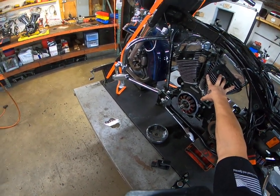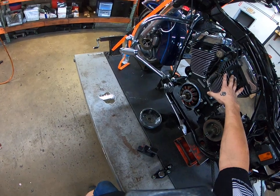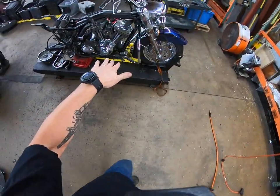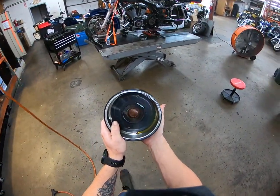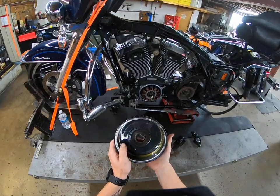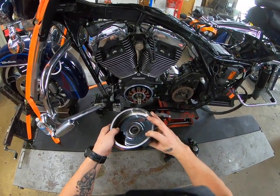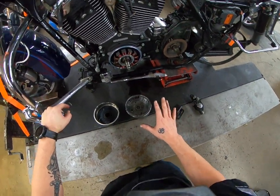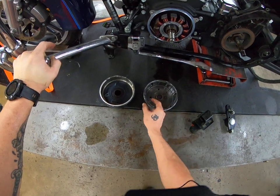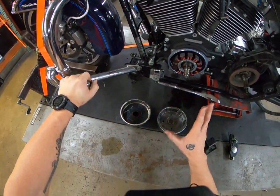We found out that in 2006 they use a three-phase 50 amp rotor that is the same part number as what is inside the Twin Cam 96. So I know that this stator will fit onto that motor just like it does for the 06. However, the crankshaft spline diameter is going to be different between a Twin Cam 96 and a Twin Cam 88 — it's not going to work. There are also differences in wall thickness, diameter, and depth that mean the three-phase and two-phase components cannot be interchanged.